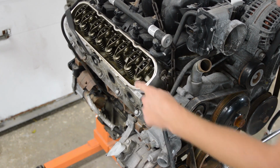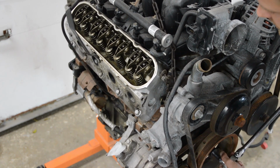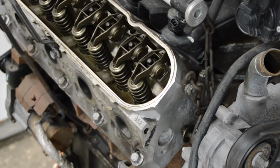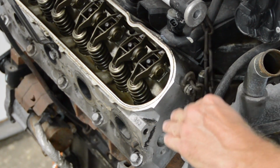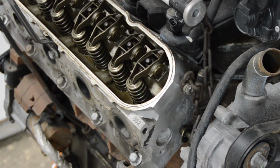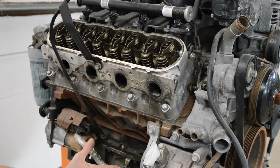Okay, so right now, we have the exhaust going down. Next will be the intake. Okay, so you can see it coming up. So now we should be coming up on the compression stroke. And I'm not concerned about the piston coming all the way up to TDC. As long as the valves are closed, we're gonna do a leak down now, okay? So that's good enough. Okay, now time to shoot some air in here and see what the leakage is.